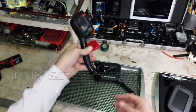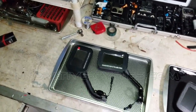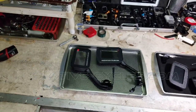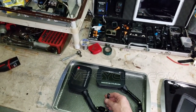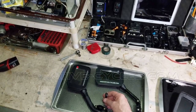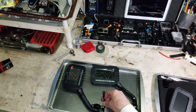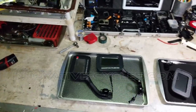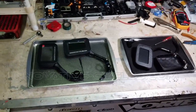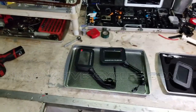As you can see they look pretty clean. The quick release allows you to take them off real quick, and they also come with a wiring harness which is very straightforward and ready to go. You just run the wires forward to the back, plug into the camera, plug into each mirror, and tie into the battery positive and negative. That's it — very simple. There's almost no one who won't be able to install this wiring harness; all you have to do is hide and zip tie the wire.